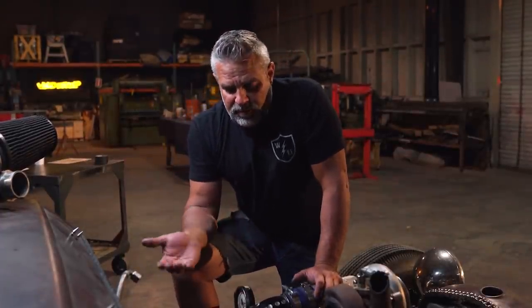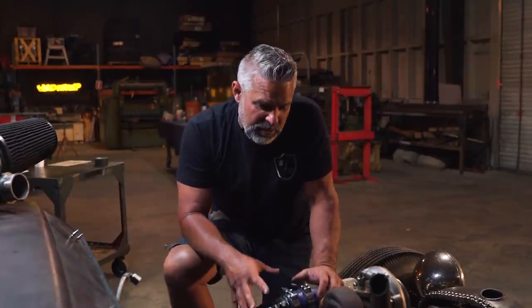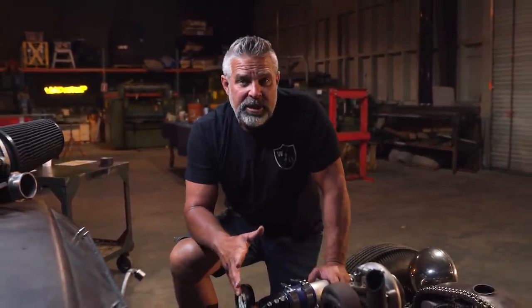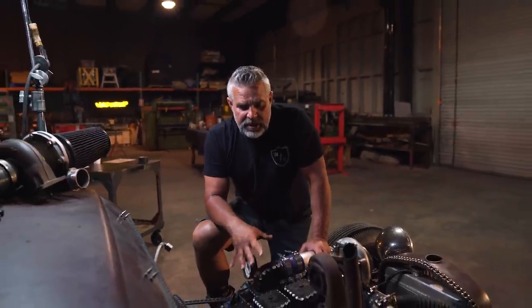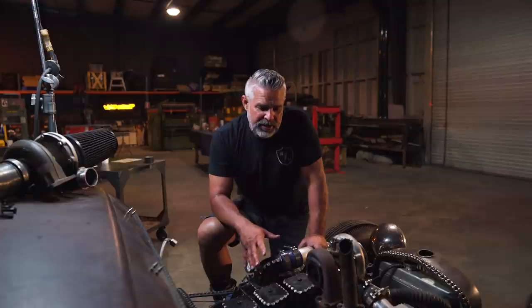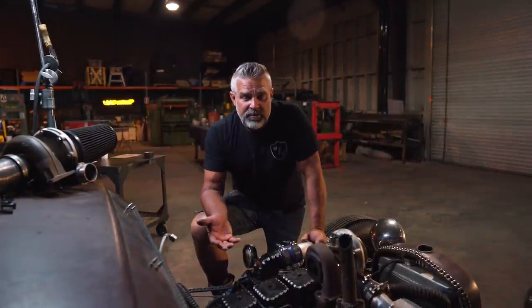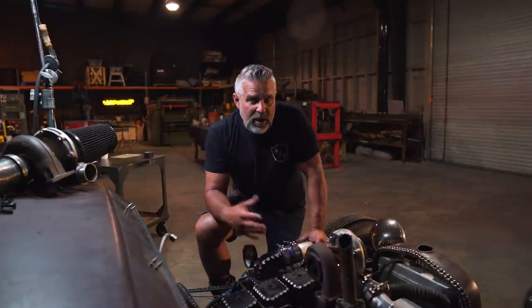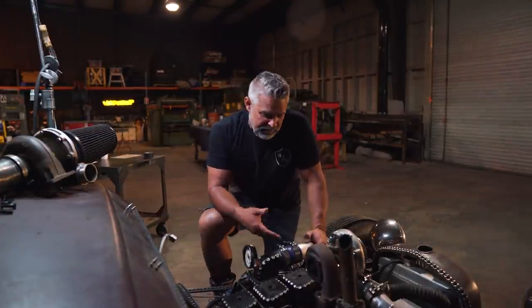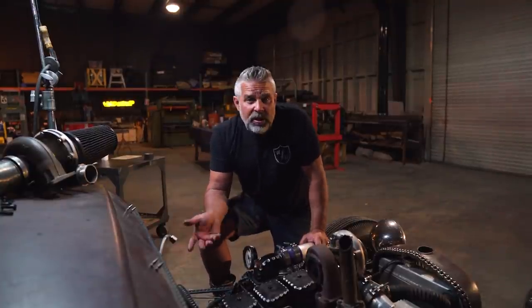But basically, you can't hurt them. The only way that you can hurt this motor, and I've even seen them with dirt ran through them for years, the only thing that they really do is if you dust them out, they'll wear out and lose compression. But you could literally throw a new set of rings in them and fire it up and drive it for another 10 years. And they run on any kind of fuel pretty much. I could run straight transmission fluid through this thing. I could run hydraulic oil in it.